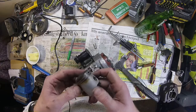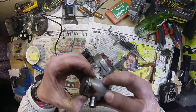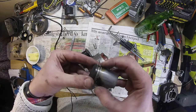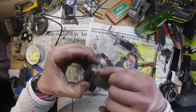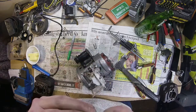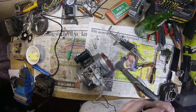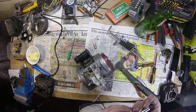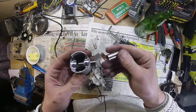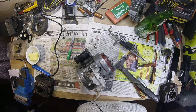Let's look at this piston. You've got a little bit coming through — obviously coming by there where you've got the ring gap. That's common because you have to have a small gap to get the piston rings on. Same over here you've got quite a bit — not quite so much because it's the second ring. That's coming by really badly there, that's the worst bit of blow-by, so that's what we're trying to avoid. That out there really doesn't look too smart either. This one looks much nicer — that one's got quite a lot of wear on it. You can see the colouration where it's got really hot. This is a nice new one so I'll fit that as well.